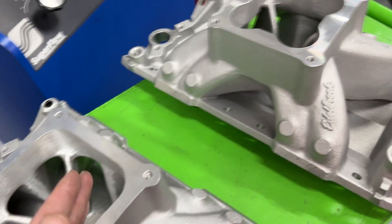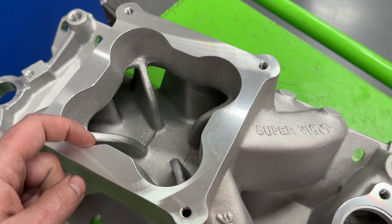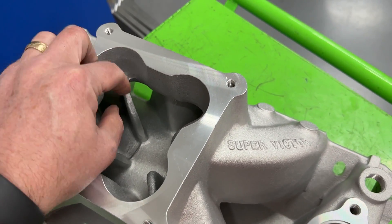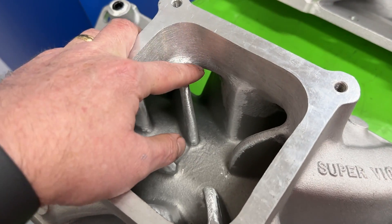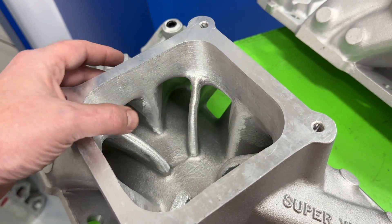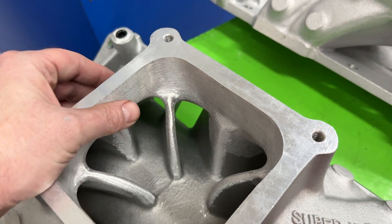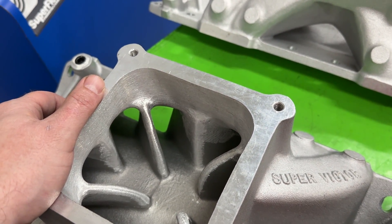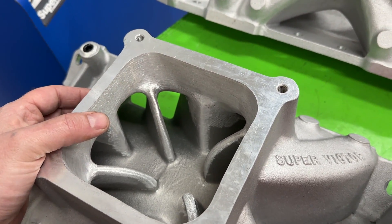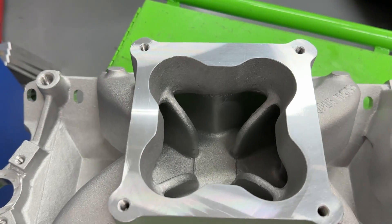It simply went from that to this. The way I did it — I didn't grind it by hand. I put it up in the mill and used it to cut across each of the four corners. Doing that leaves kind of a ledge, so you have to blend it in, which is what was done — not trying to open up the ports larger, just rolling that corner in where the mill leaves a sharp edge. I also did those dividers, and I know you're thinking that's got to be worth something. No — in a previous test with a Victor Jr., I did that rounding on dividers and it did absolutely nothing.